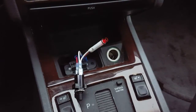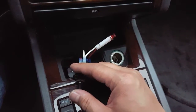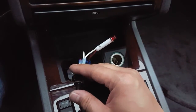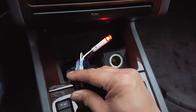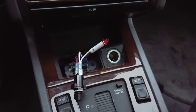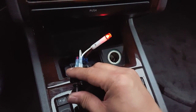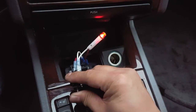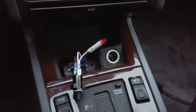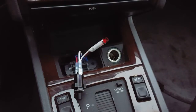To try to clear the code, one thing you can do is push and hold this button for five to seven seconds. The red LED should come on in about three seconds, at which point you push and hold again for five more seconds. That should have cleared the codes.